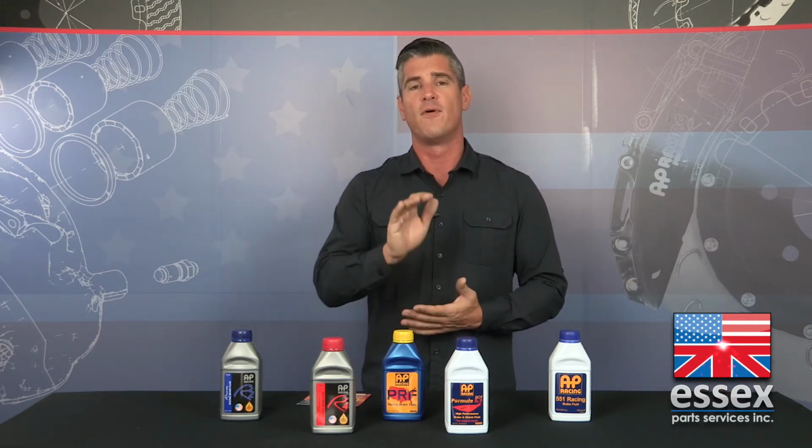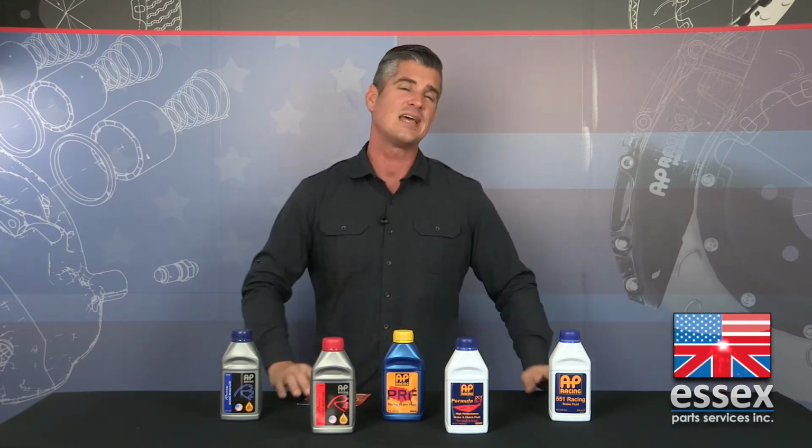We all know that water turns into vapor when it gets hot. Vapor is compressible, so when you go to apply the brakes, the pedal may go all the way to the floor before your calipers respond. Step one is testing your brake fluid.